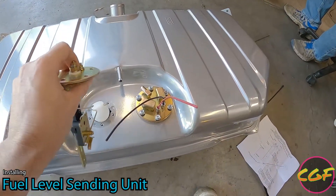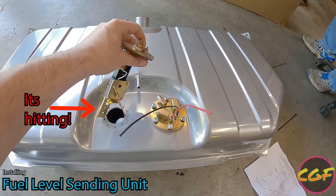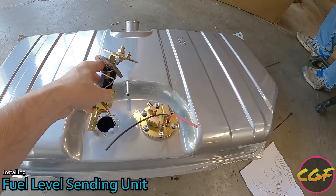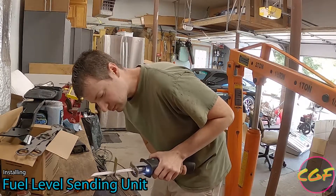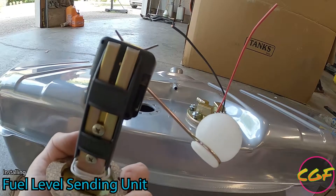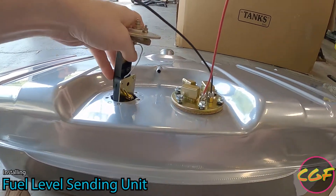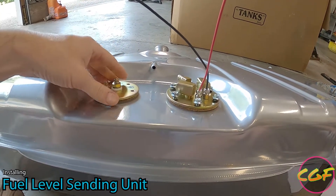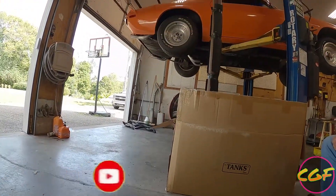When it comes to putting it in, you can see it won't physically fit, so we're going to cut the bottom of this bracket off right down here. After cutting and reassembling, we're not quite halfway in but we're still not lower than the bottom — and now it actually fits, doesn't bottom out, and we know it's otherwise correct. We'll get some screws in there so things don't bounce around while we're moving it, then we'll work on getting the stock fuel tank out of the car.